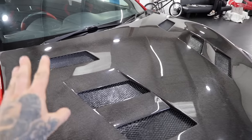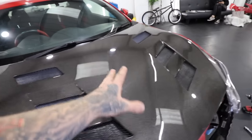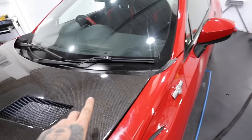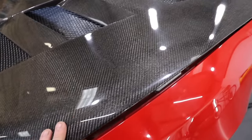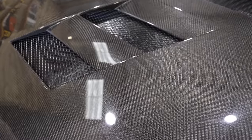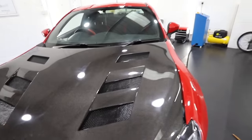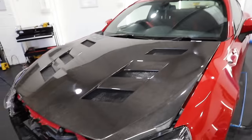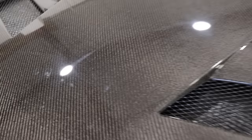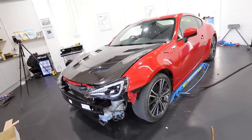I love the bonnet, but I think we have an issue. The hinges — which does normally happen when there's damage to a bonnet in a crash — are definitely bent. I put it in loose, but as you can see, one side is literally touching and down here there is a gigantic gap. I think the bonnet hinges are going to need to be replaced. I'm going to try and bend them a bit and see if I can work it out, but I think the bonnet hinges have absolutely had it. The carbon does look actually sick though — that's made it look so much more aggressive.